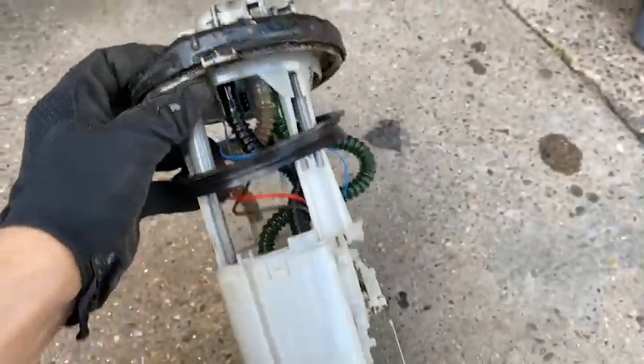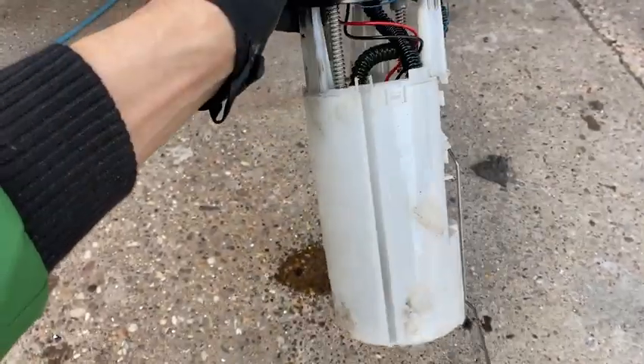My Defender 90 TD5 stopped working about two or three weeks ago — it just wouldn't start. I tried everything, including getting the fuel pump out by cutting a hole in the load bay to access it. I got the fuel pump out and checked it over, but unfortunately when I bought a new fuel pump, it wasn't the fuel pump. So I spoke to the guys at Alive Tuning who did the stage two remap on my Defender. They said send the ECU and they'd look at it — it could be topside switch failure, which is a common fault in the TD5s. Anyway, they sent the ECU back and I haven't unboxed it yet, so let's plug it in and see what happens. I'll tell you a bit more about the story of my ECU.